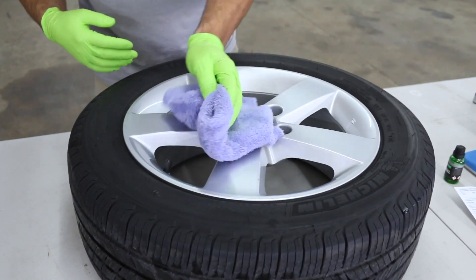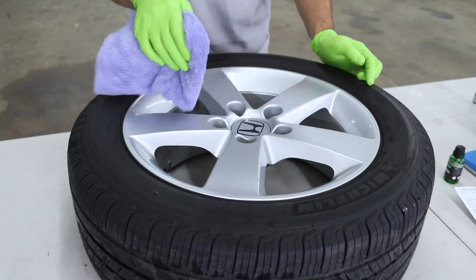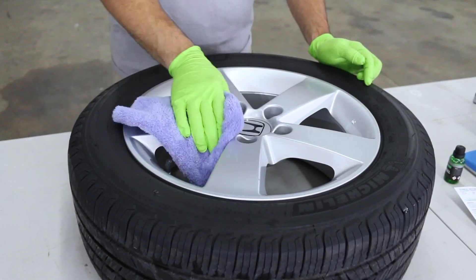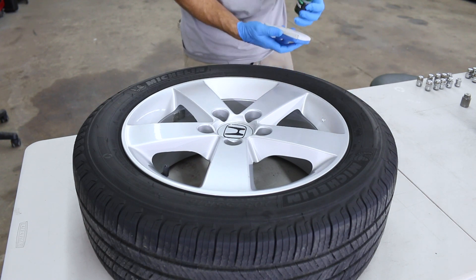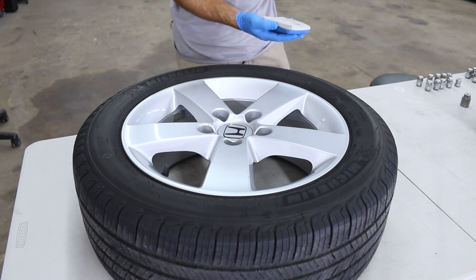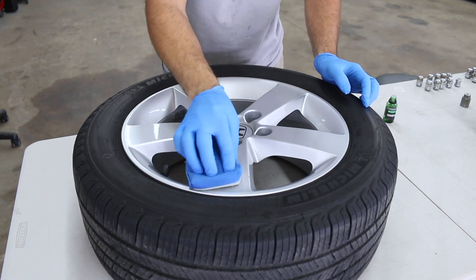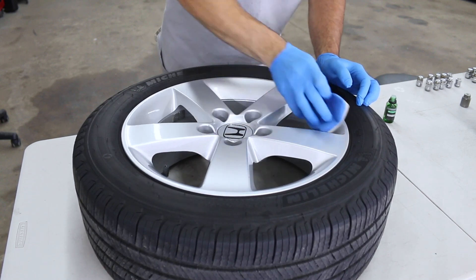With black wheels, make sure you don't have any high spots. I'll do another video eventually of some nicer wheels that I'll spray or airbrush and polish beforehand. Then wait one to two hours depending on temperature — it was pretty warm in the shop today so I waited about an hour — and then apply a second coat of the coating, basically the same way as the first coat. The first time I used the blue side of the applicator; now I'm using the gray side.